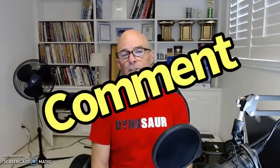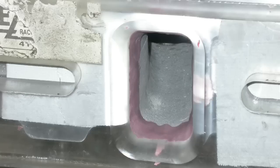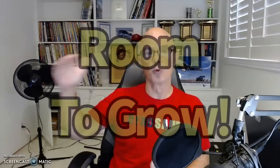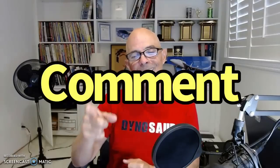I know some of you will comment: Richard, you didn't do a direct back-to-back test — how are you coming to this conclusion? Well, I'm using the airflow data — the 185 flows more than the 165 at every lift range — and the dyno data showing the 185 did not lose any power compared to the stock head even down low. The port size is right, the valve sizes are right. I've used them both dozens of times and never had anything but good luck with the 185. It also allows room to grow, since the 185 head will support almost 600 horsepower if you ever put it on a serious stroker. Make sure to like, share, subscribe, ring the bell, comment, and I'll keep testing.